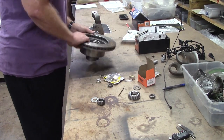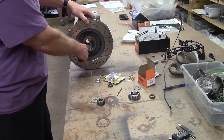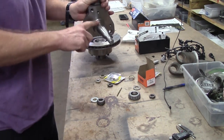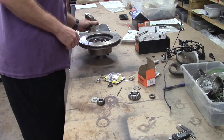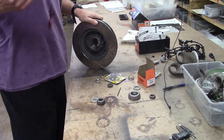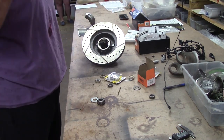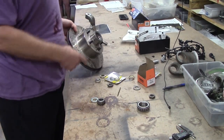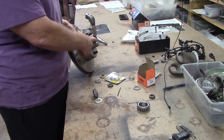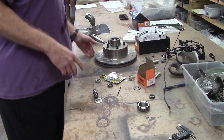We take into account that we've got a rotor that rides there and it's based on this bearing right here on the inside. So if this is off by 3 or 4 thousandths, this distance could vary — that's one variable. Now we're going to talk about the race depth and different brands of bearings. If you believe they might be within a thousandth of each other, you are sorely mistaken. We take into account the outside bearing and race, whether or not it's exact, whether the race is off one or two thousandths. We've got all these variables that could change just a little bit. It's called manufacturing.